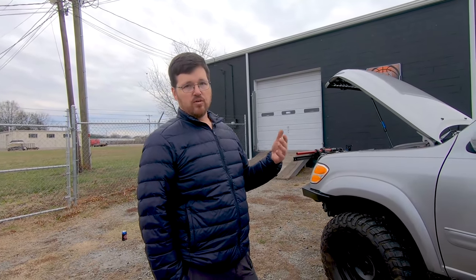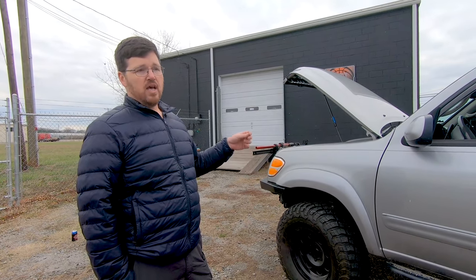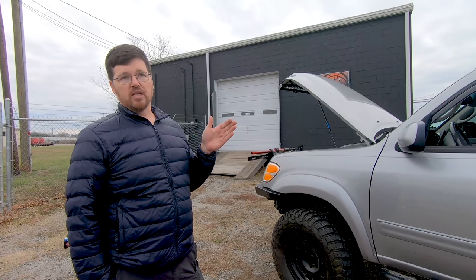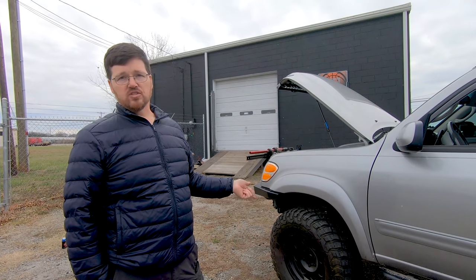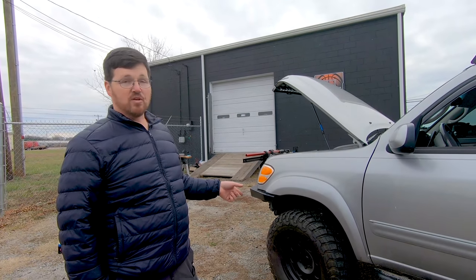Leave a comment below if you want to see a three-link solid axle swapped Sequoia. Braking on these Sequoias is pretty limited — Scotty from Addicted Off-Road was probably the first to pioneer a GX 470 brake upgrade, and people have gone further with a GX 460 upgrade. It's the same rotor diameter — a big brake kit for this — but with a thicker rotor and even bigger pistons in the GX 460 calipers. On the Dana 44 I'm running a Ford axle with Chevy knuckles and spindles — six-lug — and I'm going to adapt the GX 470 brakes to it.